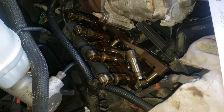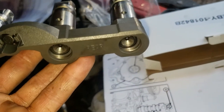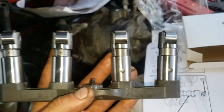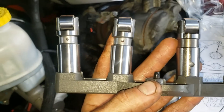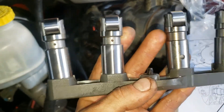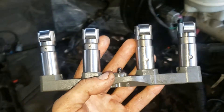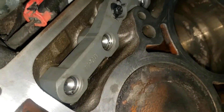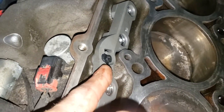All the troublemakers out, throwing new ones in. Still leaving the MDS on this one. These are rear — they're different sizes and look a little different. This one has holes, these ones don't. The bigger ones are bigger, the smaller ones are smaller, so you can't mess it up. Dropped in the new MDS lifter assemblies — front labeled as front, rear labeled as rear. Those number eight bolts here are going to be tightened.